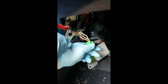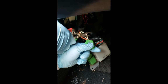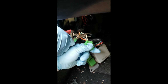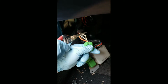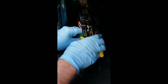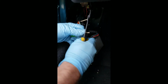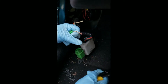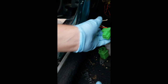So you only get one chance to do this, unless you want to order a new wiring harness. So be sure to keep enough room and cut back far enough away from the connector. Some people get scared, but you just got to build up confidence and go for the cut. And now Andrew will strip the wire to expose the copper. It might be a little dicey to get to, but once you cut it, it'll pull straight off. Just like that. Now he will do the next thing for the second one.